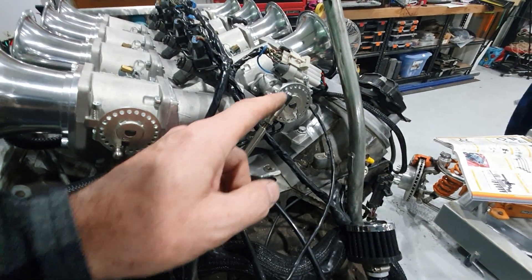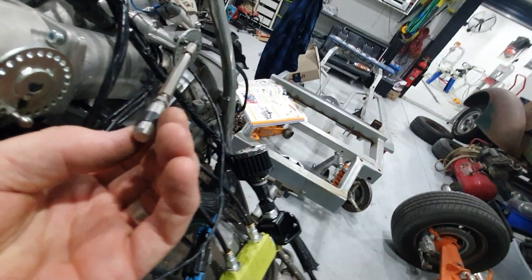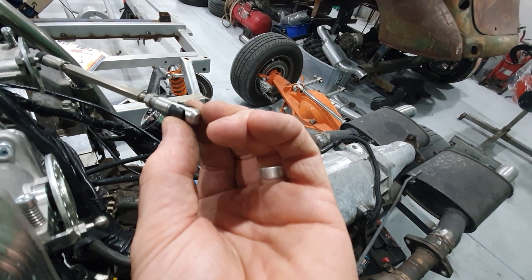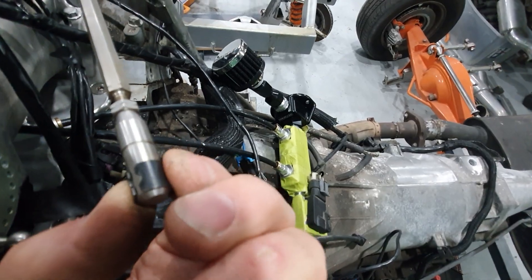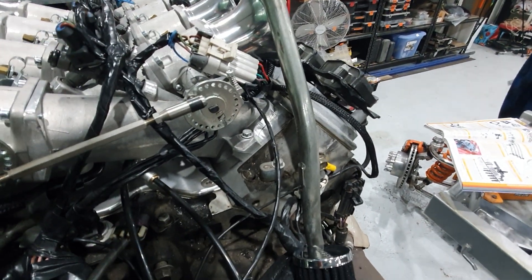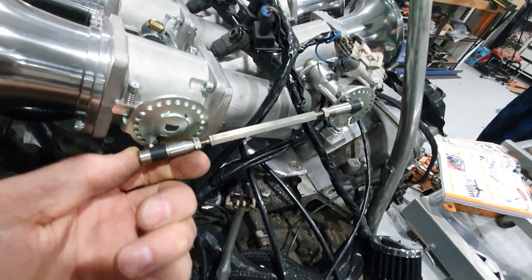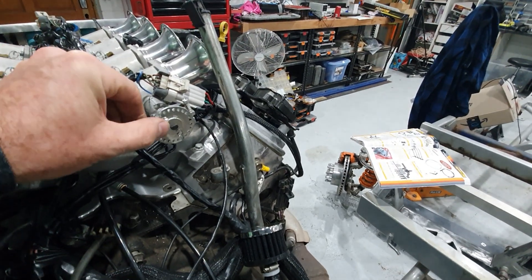So I had to drill out the hole at the right spacing — you can see I drilled one at the top and one at the bottom. That little hole there slides over the ball and this little spring sleeve slides up over the top of it and locks it in. It's got a couple of little cutouts in that spring, so it slides up around the neck of the ball. You put one side on fixed, then adjust the other side so the ball just slides straight into that hole with no pressure. Spin it around, slide that little spring clip over it and it's snug in there.